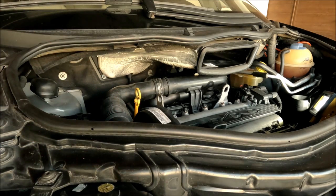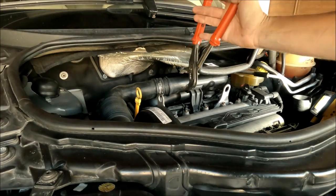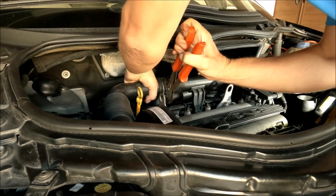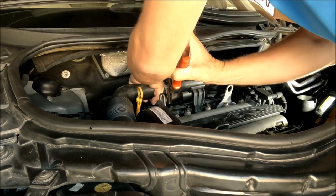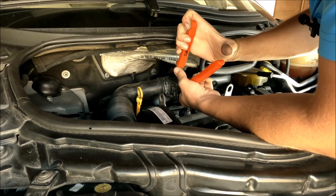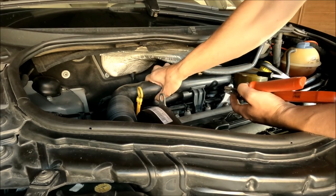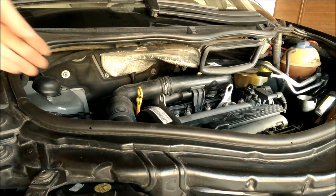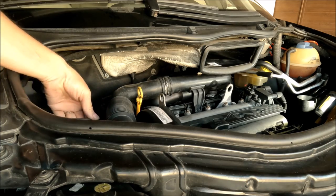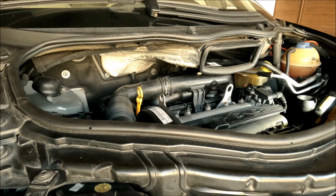The plastic part is now fixed — it is also fixed to the throttle body in both grommets. Now I put this rubber hose back on using the clip tool and push it in. There are alignment marks that need to be aligned. I put the clip for this hose back on its holder. Job done physically — now we need to adapt the throttle body with VCDS.